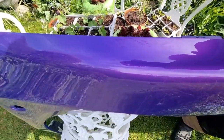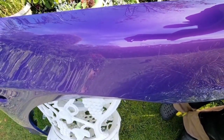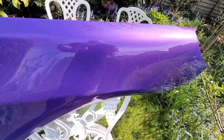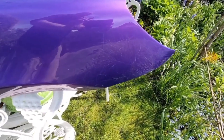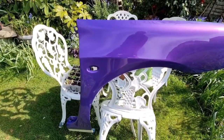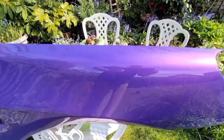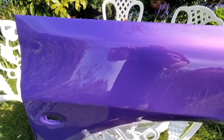It does go off hard after a week or so. Gloss levels - it retains its gloss levels pretty well. With the extra fast hardener you do lose quite a bit, so try and avoid that if you can - keep to the fast, which still goes off quite quick anyway. For UV, I've used this on cars that have spent four or five years in Spain with no detrimental effect, so I think it's quite good for that. This one requires two full coats whereas the rest are just a tack coat and a full coat.